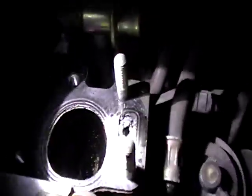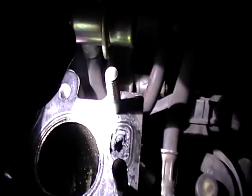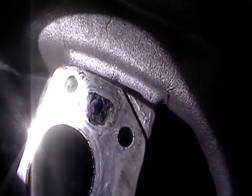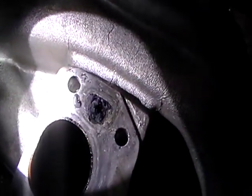The intake is off, right there on the floor. I'll show you what you need to do. Over here on the right side, as you can see, this thing right here is all clogged up. What you do is just get brake cleaner and air and clean that up. Also blow everything out of the EGR. So that's the thing that got clogged up. Also on the intake manifold, this thing right here is also clogged up. We'll clean it up and I'll show you how it's supposed to be.